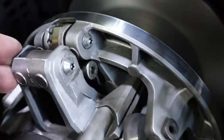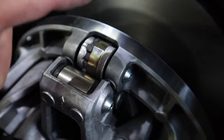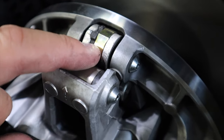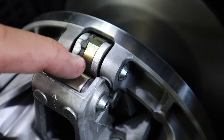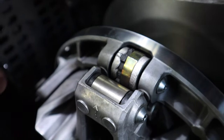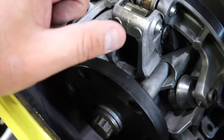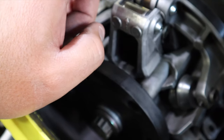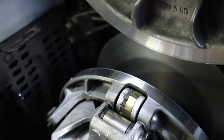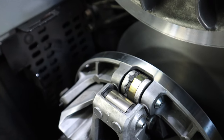Let me show you what we're working on here. This is one that's already been replaced. This is your clicker assembly that is attached to your ramp, and right here is your roller bearing. This guy takes some abuse. When this clutch fluctuates in and out, that roller is what keeps everything running smoothly. If your clutch is engaging, this roller is moving. So you want to make sure that you take really good care of these, keep them lubed, and make sure that these bushings aren't worn out so they just slop around.